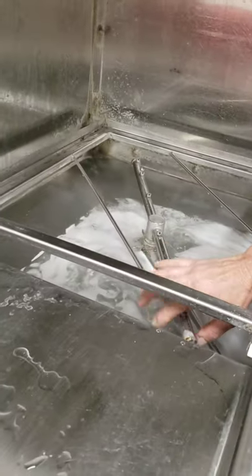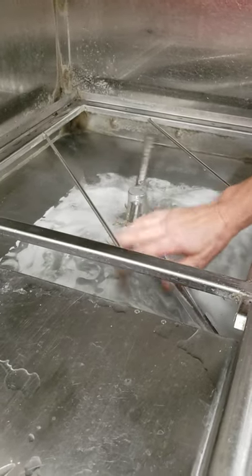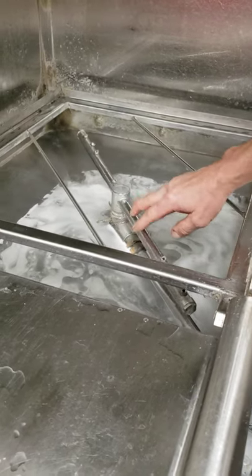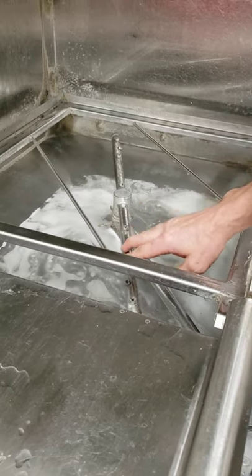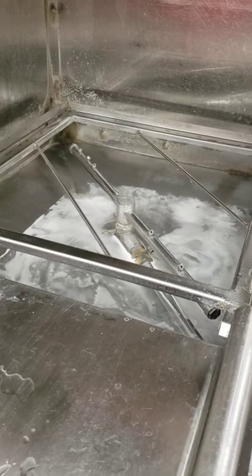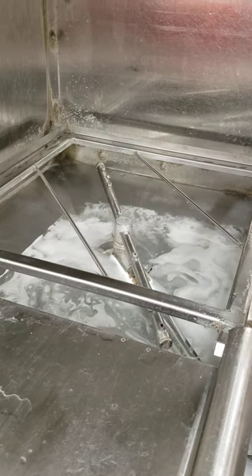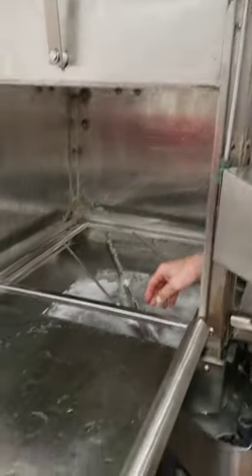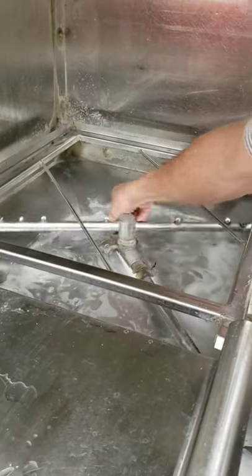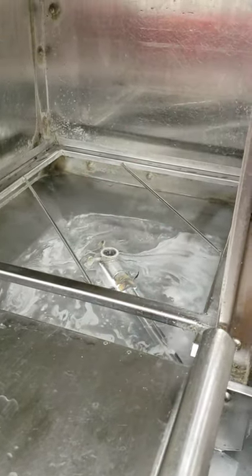I'm looking at this spray arm on the bottom, and there's a nut right here on the end of the spray arm. I'm going to check and make sure that nut is tight. There's one on each end of the spray arm. Now you can see you have three to four jets on each of your spray arms. There's a spray arm at the bottom and another at the top. I'm checking those nuts on the ends to make sure that they're tight. About once a week, you should take this spray arm off — you do that by unscrewing these two set screws about two revolutions and the spray arm comes all the way off.